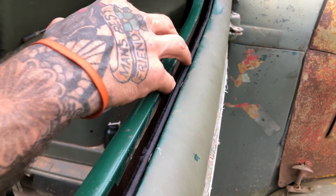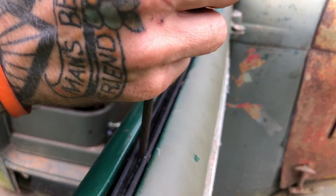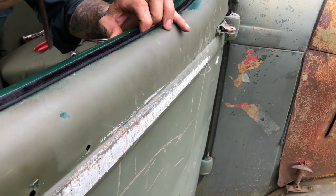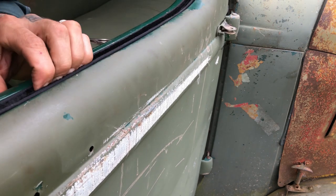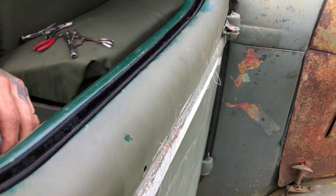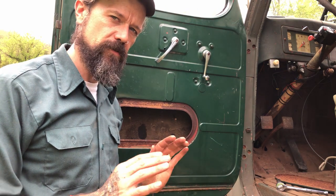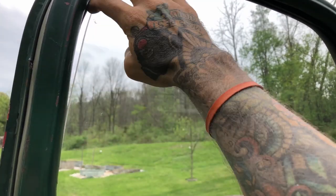We're back up on top here. The window is down recessed into the door. I think I've got the felt perfectly spaced — much like the channel clips, your screwdriver is your best friend on this. It's just off by a fraction of an inch; you can usually manipulate it by pulling on it. Make sure all your felts are flat, all your channel is good, everything. Now the window is seated perfectly — but if it still doesn't go up correctly and you still have a gap or crack right here, I'm going to show you how to fix that.